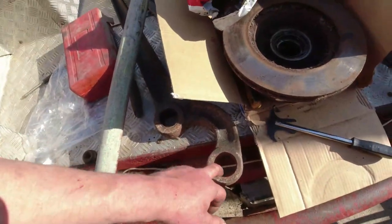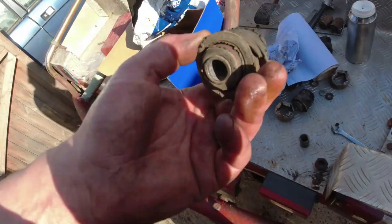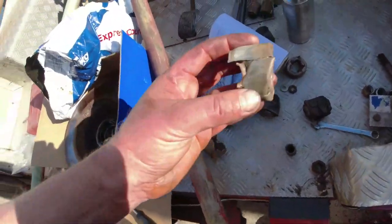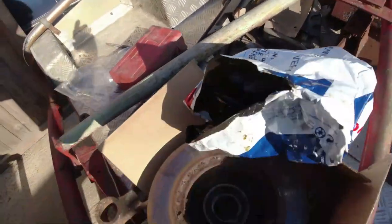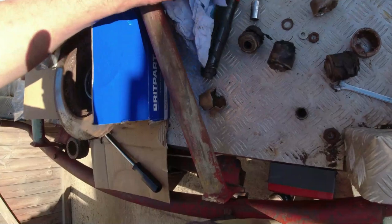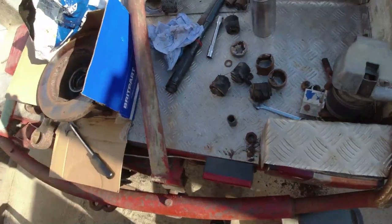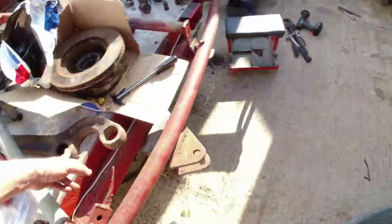This time I opted to push the rubber inner section out using a toughened socket — they come out easily that way. Once the rubber inner's out, I use a reciprocating saw to put nicks on the edge of the metal ring, then a three-pound hammer and a brick chisel to knock it out. It's a bit of work, a bit noisy, but far safer than using a press when you're not sure how much tonnage you're putting in. So that's done — just one more bush to go. The reciprocating saw ran out of battery so it's charging, and I thought I'd get on with the hubs.